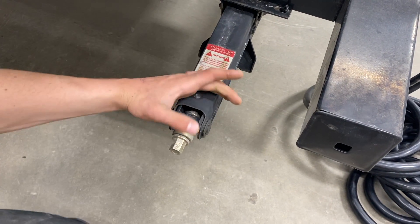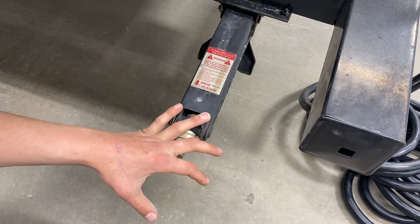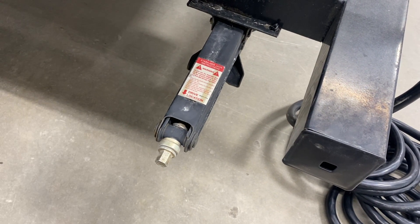Right here, and in each corner of the trailer, we've got a stabilizer jack. Walking through the unit, you'll notice it's got a little bit of bounce or sway to it. These jacks come down to the ground — give them another turn or so to firm them up, and that'll get rid of any bounce or sway.